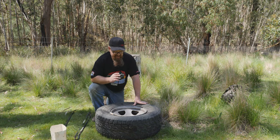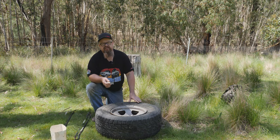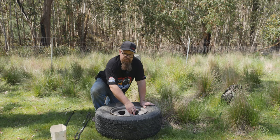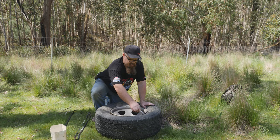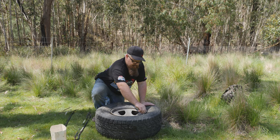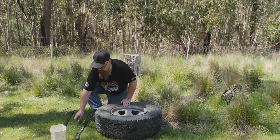Now we're in the shade, a little bit cooler. Tyres go on and off one way, because of the drop well, which we'll show you later. Make sure you get the orientation correct - these are usually balanced - so I'll put a bit of a mark here on the tyre just so we know that lines up with the valve.